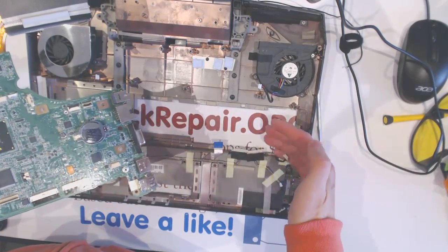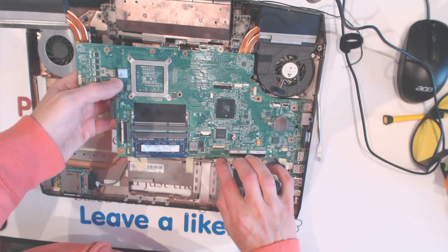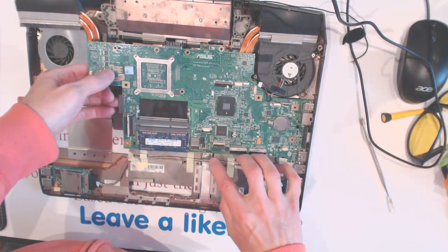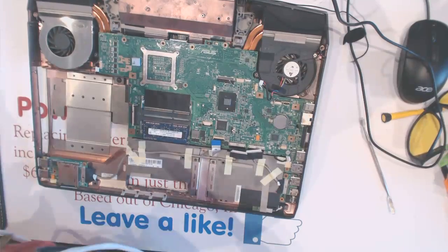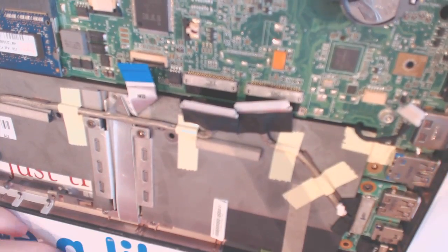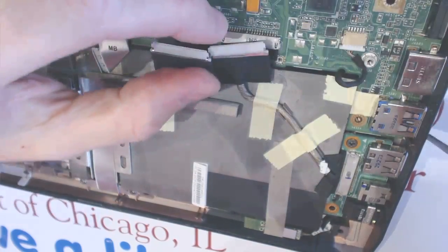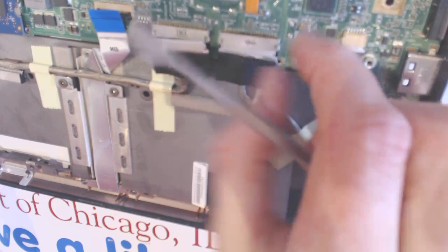And the way you put it in is take all those 4 cables with 4 fingers like that, slide the board this way, pick up this cable right here, and it should sit properly in there, right? Okay. Now what you want to do is connect the cables here. Alright, so you want to connect the cables right here, like that. You want to connect this cable right here. Lift up the motherboard a little bit from the left side and slide this guy in place.